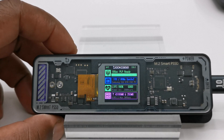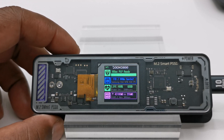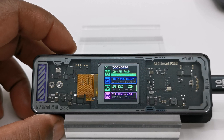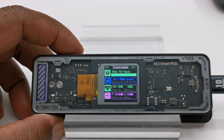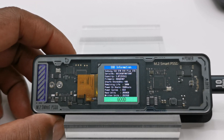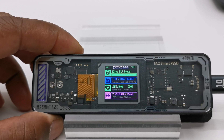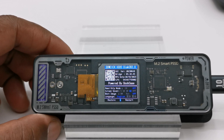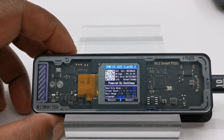To navigate the menu you use a combination of long press, double press, single press, and timeouts. To navigate to the next menu, press and hold and allow it to scroll through its various menus, then release the button when it lands on the menu you'd like to access. The next menu is SSD information, where you can see every bit of information about the installed SSD, down to its serial number, firmware version, and the number of hours it has been in use. The next menu, called About Me, displays its UI version, a barcode to access the DockCase website, and the chipset serial number.